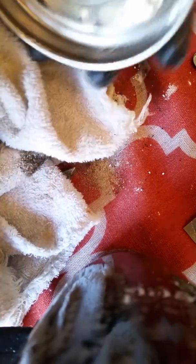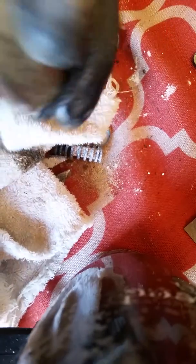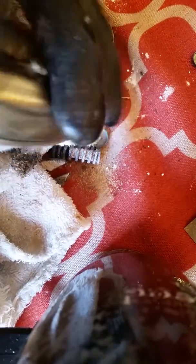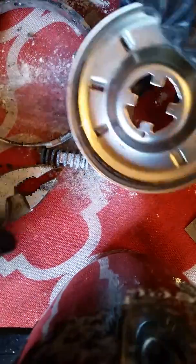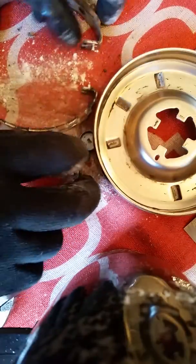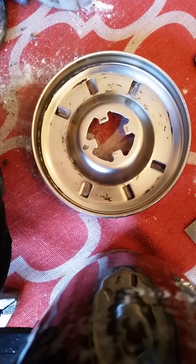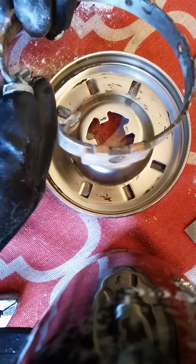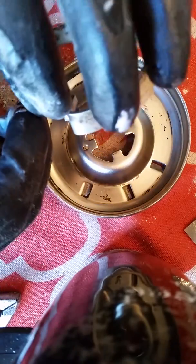The powder will actually make it a little bit slipperier. You don't want to add anything like glue or adhesive — I've seen somebody put adhesive over a dryer belt to make it stick to the tub. You actually want some slip, because if it's overloaded you want to protect your major parts. The transmission will cost you a hundred-plus dollars, while this is about a 30-dollar part if you bought it brand new. So basically now we're going to put everything back together the way we found it.